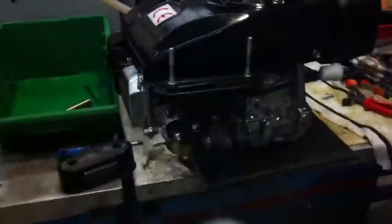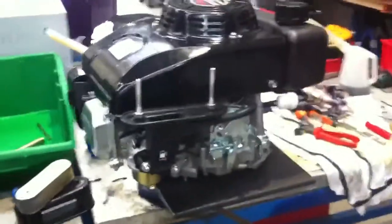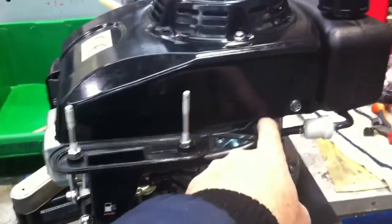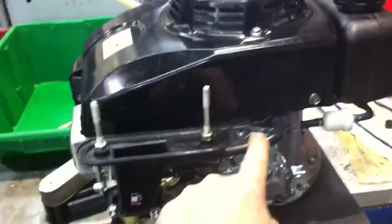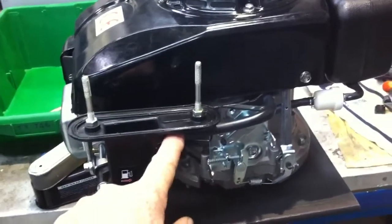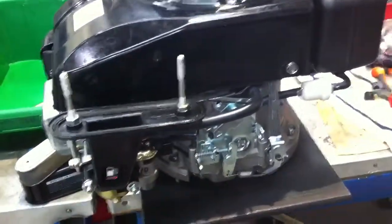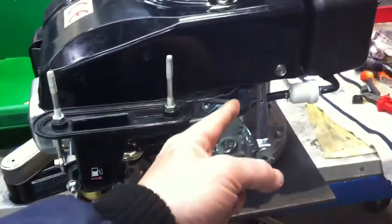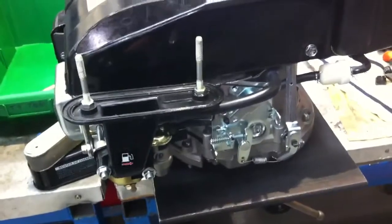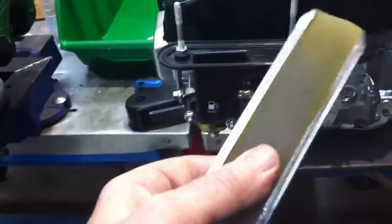What we discovered was that we had stripped and assembled this engine and done extensive work on it. But the problem was, if you look here, you can see a pipe that runs into the crankcase — it's the crankshaft ventilation pipe. When we had the engine turned sideways to carry out the various functions, some of the engine oil found its way along this pipe and into the air cleaner, and what it did was saturate the sponge pre-cleaner with oil.